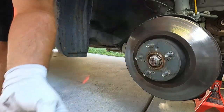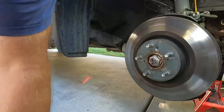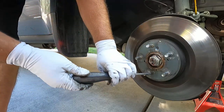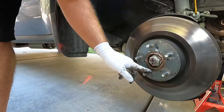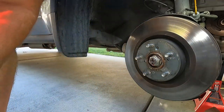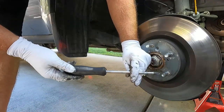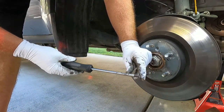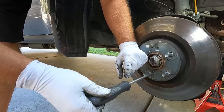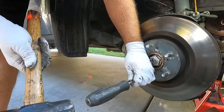You can even reuse these screws, but if you screw them up or they get stripped, I'll put a link in the description to some replacements as well. The company Mission makes them — same company that makes the caliper hanger. By the way, these are not Phillips screws. I used to use a number three Phillips on this, but this is a JIS-3 — Japanese Industry Standard — it definitely sits in there better. Just hit it a few times and it seems to break it loose.